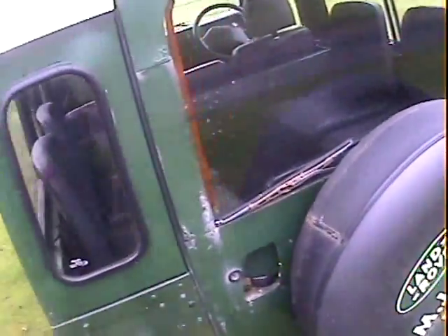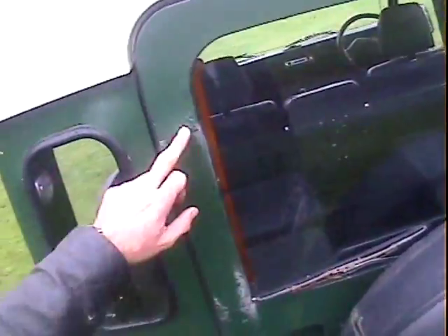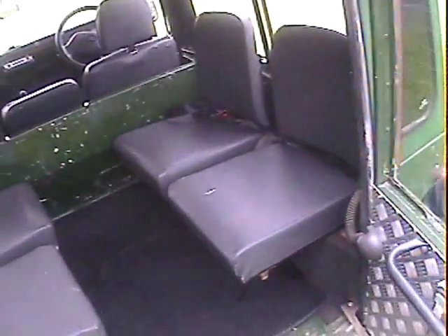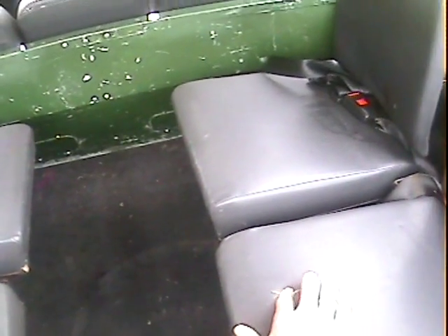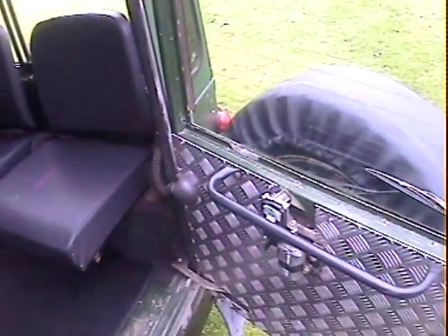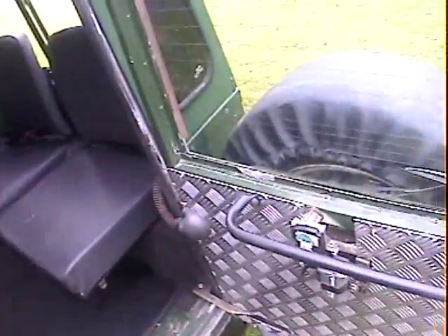Around the tail end there's the usual electrolytic reaction and paint loss on the tailgate — that's where they all do it. Inside you've got four individual rear seats with seat belts. There's a small two-inch nick on one of the seat bases but otherwise pretty good. There's checker plate on the rear door and the cover for the rear wash wiper. The frame on the tailgate has been repaired along there.